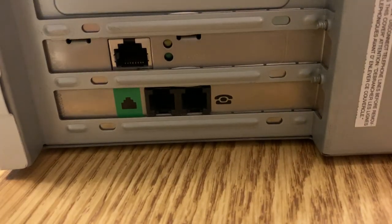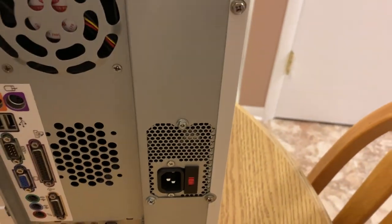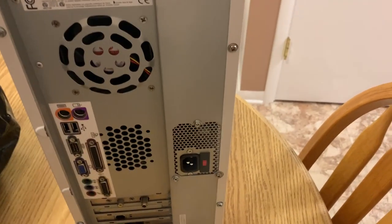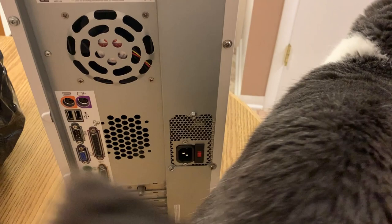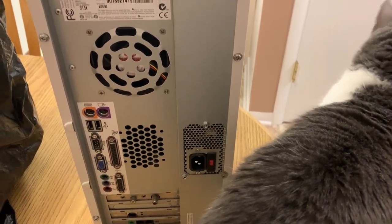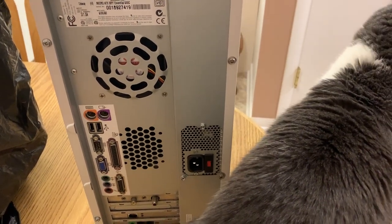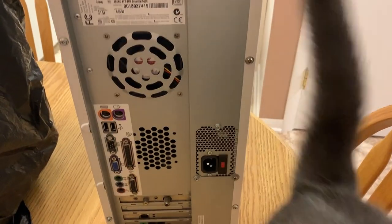And the original 56K dial-up modem it came with. The power supply is 90 watts, I believe. I had an odd issue when I first got it — the fan was actually installed backwards, sucking air in and blowing inside the PC. I reversed that myself and now it properly pulls air from the machine and blows it out.